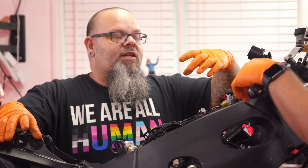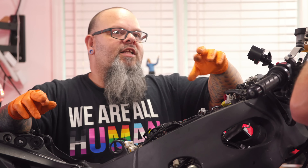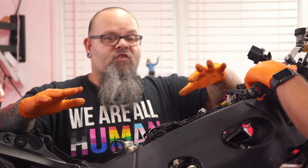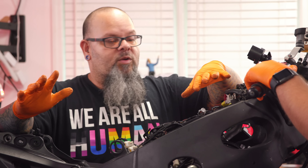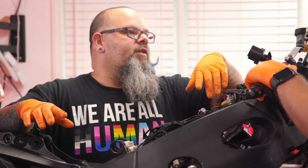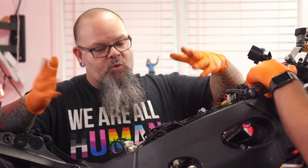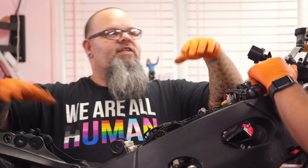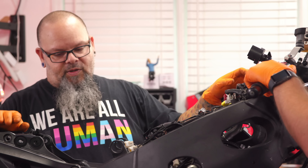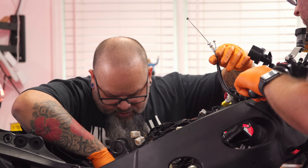It creates a lot of heat because you technically have a very lean situation in the cylinder, and it can get so hot that it'll literally melt a hole in the top of the piston. That doesn't happen too often in a four-stroke engine, but in old-school two-strokes if you had an air leak it would lean the motor out and melt a hole in the piston before you even knew what happened. That's why there's a sensor attached to the ECU - it'll throw codes and alert you.